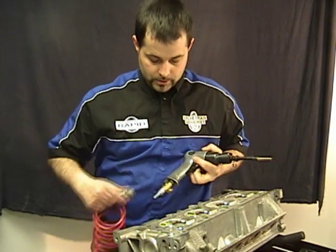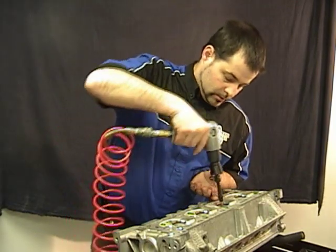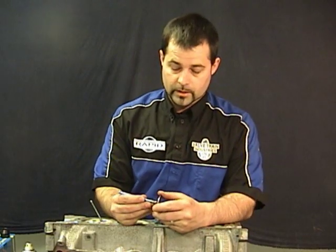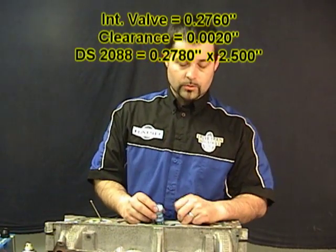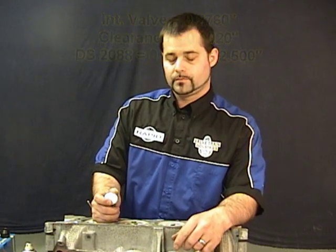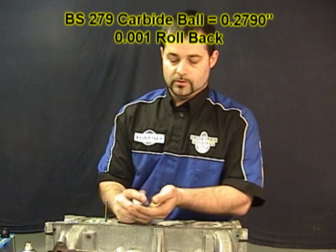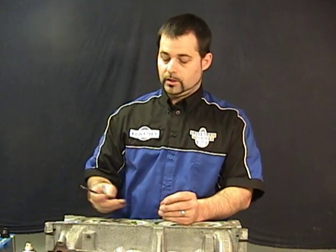After that, install the air and make sure the regulator isn't set too high. Get over the top and drive it home. Our intake valve we're using has a 276 stem diameter; that's why we selected the 2088 liner. The 2088 has a 278 minimum finished ID, which will give us 2 thou clearance. In order to size to that, we have to use a 279 ball due to the fact that there is always 1 thou roll-back in the material after you size it. We can also use our carbide broach on a stick — it's the same ball, just mounted on a stick.